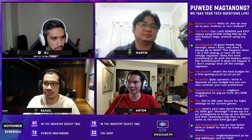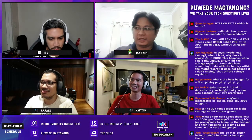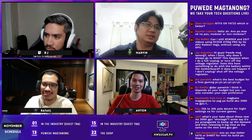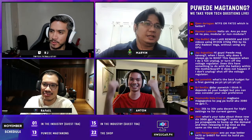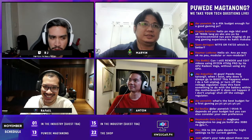John Manalo from Facebook asks, any tips on how to make a static-free workstation when building a computer? The free way is just to ground yourself, like you touch anything metal, and that rids you of your static. But have you guys tried any other solutions, like the straps? Personally, no. That's all I do. You touch the top part or the back part of your casing for a few seconds. Basta metal, yeah.